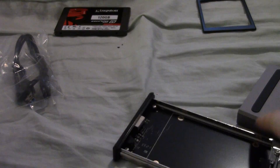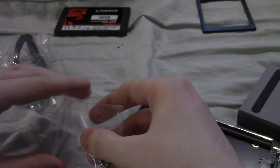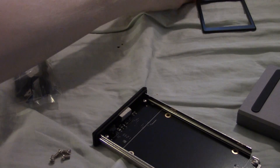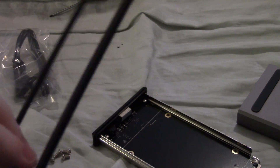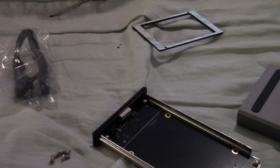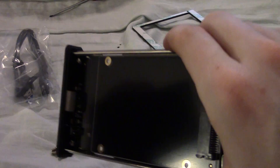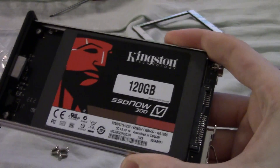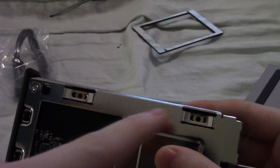There's our power and SATA connector for our SSD. There's no Phillips head screwdriver included in this one, though most drive enclosures that require tools will include a small screwdriver. I already have a little screwdriver here. Also, your SSDs may come with a little spacer — this is designed to give it a little more thickness if the drive fits loosely in the enclosure. We'll take our SSD and drive caddy, slide it in, line it up, and push it into the connector. Then turn it over and secure the SSD in the drive caddy with the screws.